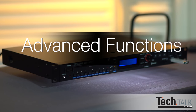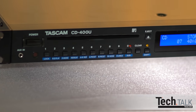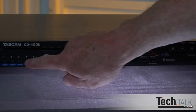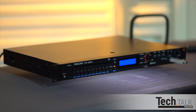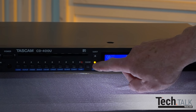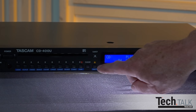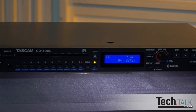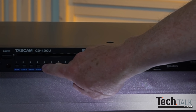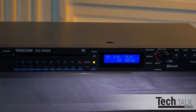Let's go through some of the advanced functions of the CD400U. With CD, USB, or SD media, you can instantly jump to any track by pressing the numerical keypad on the front panel or remote, and then play. The shift button on the front panel engages many of these functions — it is identified in blue text, and the numeric buttons have blue functions underneath. Pressing shift lights the button, then pressing the button with the blue function engages it. For CD only, you can set A and B marker repeat points, and the audio will continuously play back between these points. This is useful for transcribing, rehearsing, or learning music riffs.